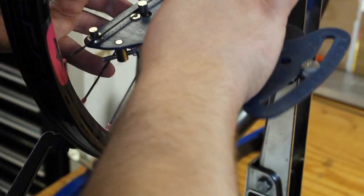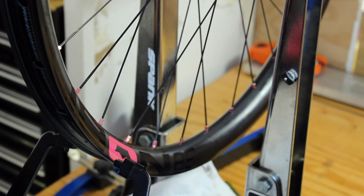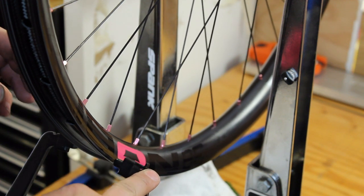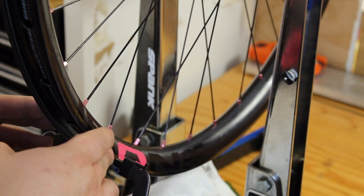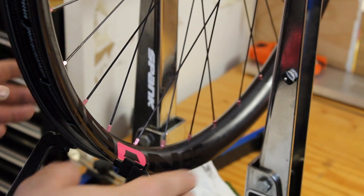The nice thing about doing the tension balancing earlier is rarely at this point do you have to do any corrections for tension imbalance. So now that we're pretty close on tension, dish, all of that, we'll just fine tune every little thing to be spot on. So I'll correct the true, I'll double check the dish, make any adjustments to correct the dish if I need to.